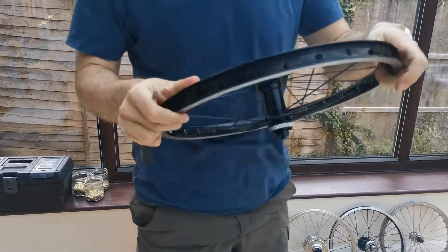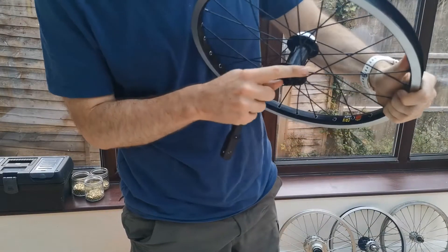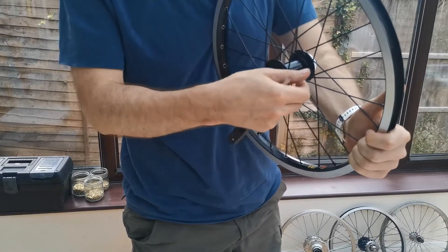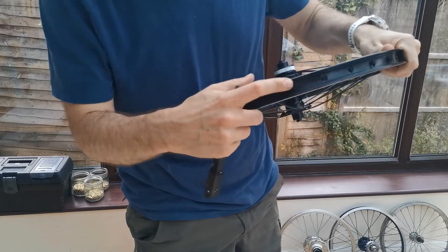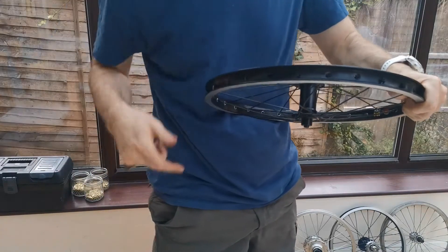I almost got away with it, but the first ones I did without properly lacing them — underlacing it — and it had the same problems I had with the old wheel. So I'm now going to have to take the leading spokes out, bend them around the inside spokes and push them back in again. Effectively, the trailing spoke nipples are just so far out there's not good enough tension in them, so I'm going to try and pull them out using the lacing.